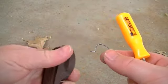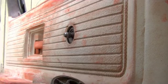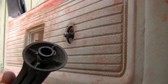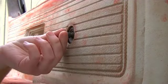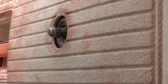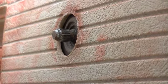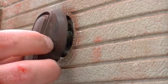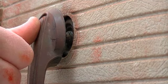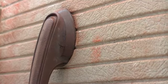Now that you've got your old one off, let me show you how to put your new one on. Getting your new crank lever put back on is actually easier than taking it off. I've already got the clip reinstalled. If you look real close at the little splined crank, you'll see it's tapered. That's why you put the clip on first — the clip will actually slide over that tapered area. You just put your crank arm on there, get it in the right position, push, and you'll hear a little click. And it's installed.